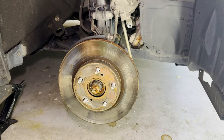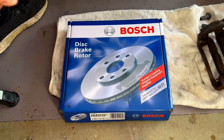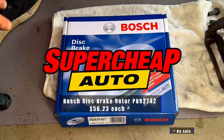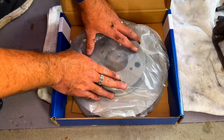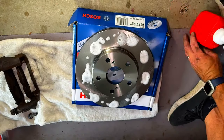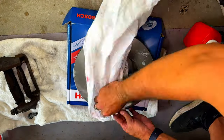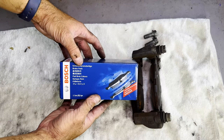Removing the rotor should be easy — hopefully it just comes off with one pull. We've gone with Bosch because it was decent quality, decently priced, and readily available at Super Cheap Auto. When you get your rotor it will come packaged in a plastic bag. Remove it from the bag and spray it with degreaser or some alcohol to get the anti-rust coating off, because the first couple of times you use your brakes there's going to be a god-awful smell.